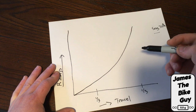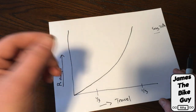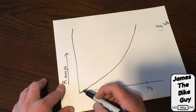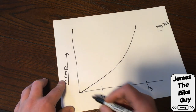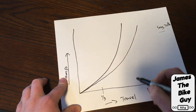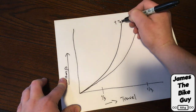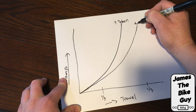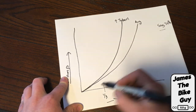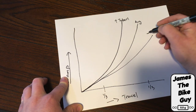To manipulate this air pressure curve you can add and remove tokens. Tokens are small pieces that actually add or remove the volume of the air chamber. If you add a token, at the same given pressure the curve instead of being average will ramp up to a much higher pressure — that's a plus token. And if you remove a token, you add air volume, and the curve comes out flatter — that's a minus token.